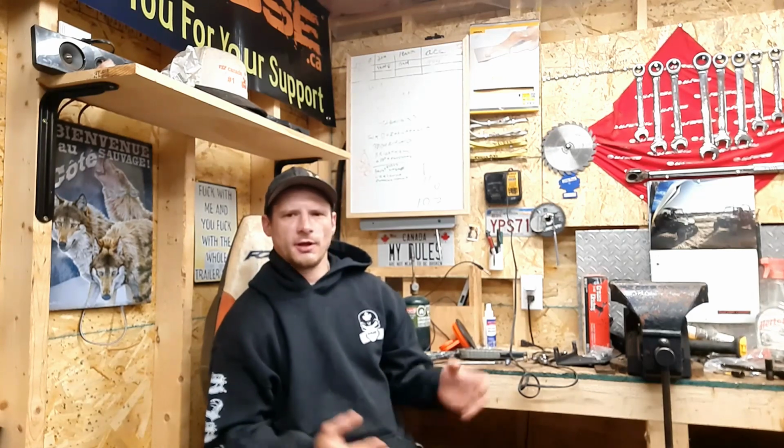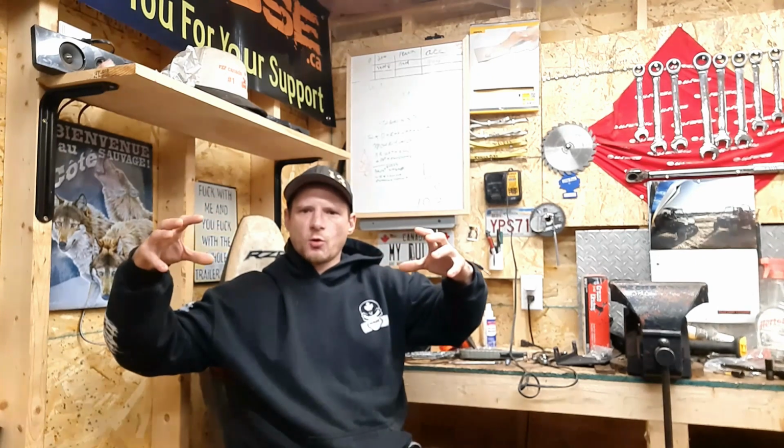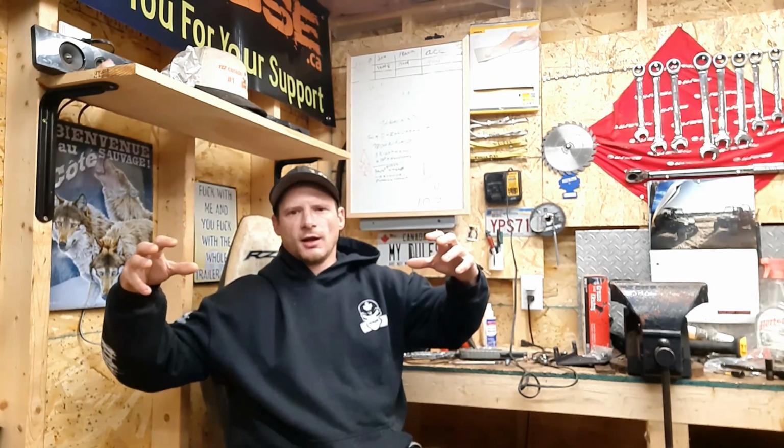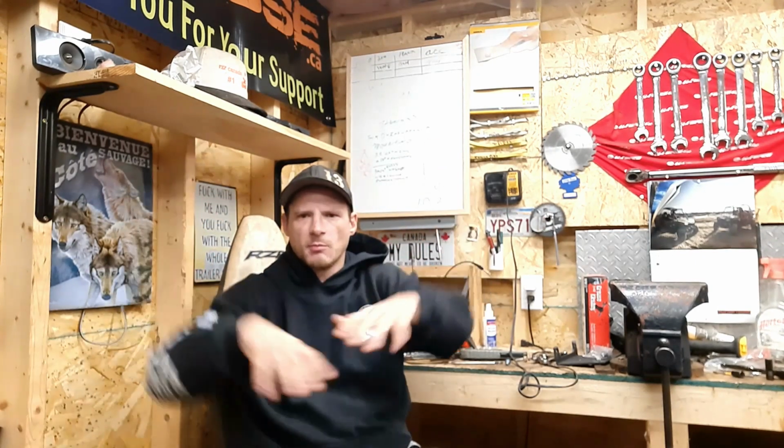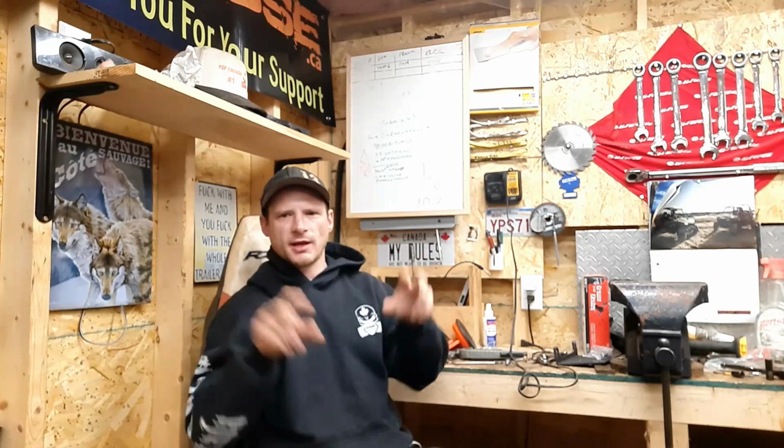It hasn't really let me down. It really cuts down on the dust entering my airbox. And also, when I'm riding in some mud, the mud that gets caked up on the corners where your intakes are, when you splash the water up, all that mud doesn't go floating into your intakes. I do get a little bit of mud into the tips because I didn't put those screens on, because I find that they are restrictive and they can choke out a machine if they get clogged up on you. So I didn't bother putting those in.